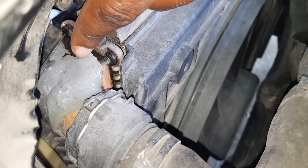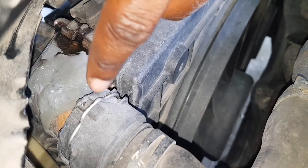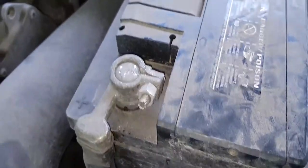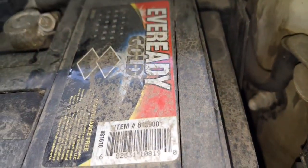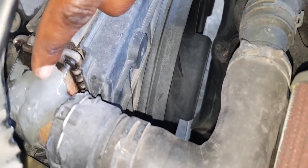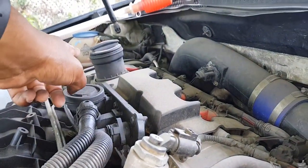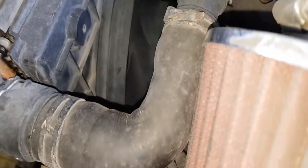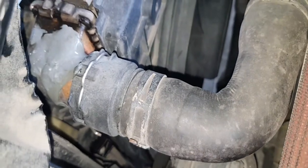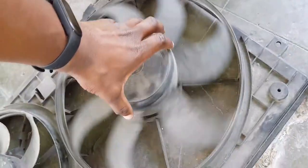I had the car idling last night while charging some batteries from the vehicle's main battery — shout out to Ever Ready Gold, available cheap at PriceSmart locally here in Jamaica. Because I didn't have this main fan spinning, pressure built up, busted the epoxy off the surface, and coolant was overflowing from the overflow port — some serious pressure buildup.